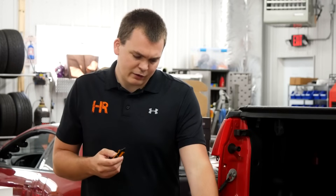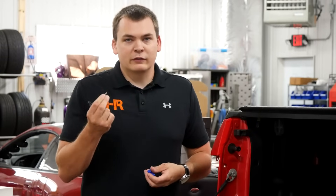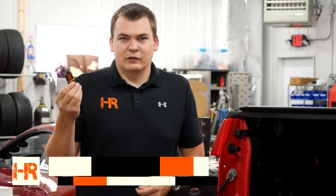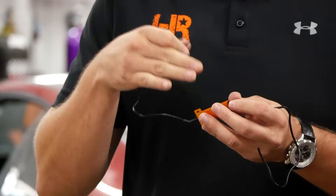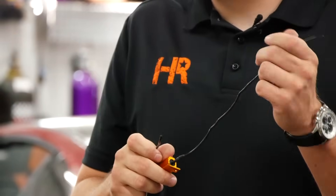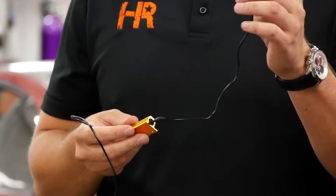It goes back to functioning just the way it did from the factory. If you buy our resistor kit — and if you're buying a vehicle-specific kit, it comes with the exact resistor you need, the mounting screw, and T-taps. Some people end up buying the wrong resistor on Amazon because they see a pack for three bucks, and it doesn't come with any of this, and the resistor itself doesn't even work for that vehicle. The resistor has two wires on it, and it doesn't matter which wire goes to which — so long as one wire goes to your turn signal wire and the other wire goes to ground. It needs to be ground and turn signal.